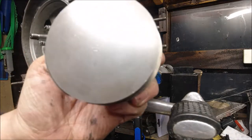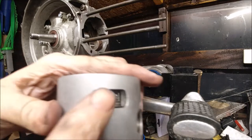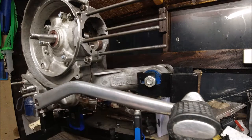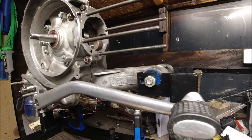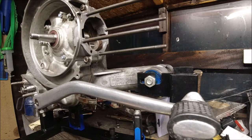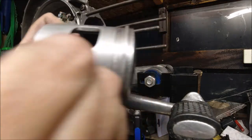With the piston, there's an arrow that points to the exhaust — I don't know if you can pick that up. It's easier with a P200 because the one port that does actually work is always on the top. So I've got my gudgeon pin, I'm just going to give that a clean up. I'll clean inside the gudgeon pin as well. It's surprising how dirty they do get inside.